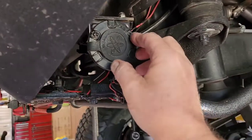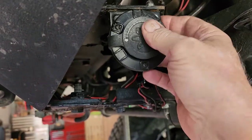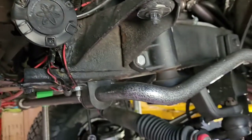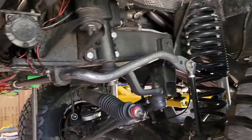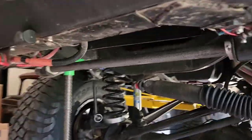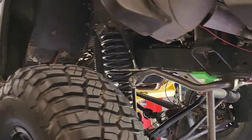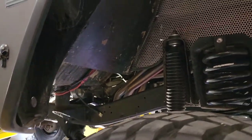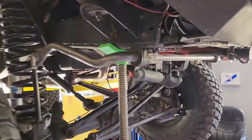This, I have onboard power, kind of neat. I plug it in and I have an onboard battery tender. And then also on the other side, on the passenger side, over on the kick panel, I have a 500 watt inverter, convert 12 volt to 110. Use that for laptops, use it for lighting, use it for all different things. But yeah, so this is just an overview. Didn't want to bore you guys. Just wanted to show you the underneath of this old girl.